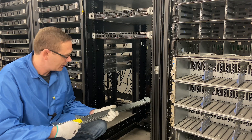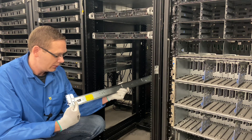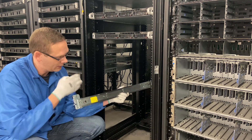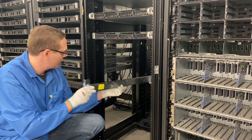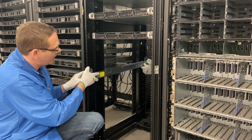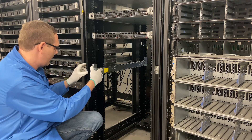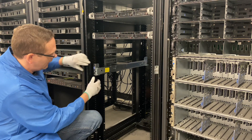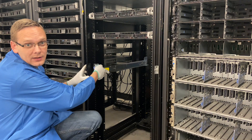So now we're going to show you how to put your server into the rack. First things first, we're going to grab the left rail — notice it says 'left' on the rail. We want to face it where 'left' is facing up and on the left side. I like to do this with two people, so Angel is going to help me — he's in the back here. Let's do positions 14 and 15. I'm going to have him line his up and put his in first. You'll hear it click into place. Now I'm going to come over here to 14 and 15 and line mine up properly, then push it in — you're going to hear it click in. And now it's officially in. If I were to try to move or shake it, it is physically into the rack.